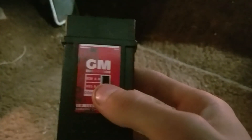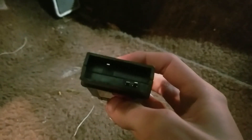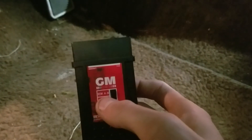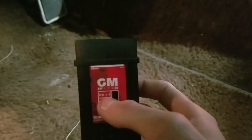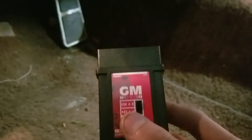Take your scan tool — this thing probably weighs less than a pound. It's got two modes: ECM and ABS. All that is, is selecting which terminals to ground. There are only three terminals on the connector. When you plug it in on ECM mode, it grounds the A and B terminals, which puts the computer into a closed or open loop so it will tell you what codes it's stored. I'm not sure this will actually work for me since my check engine light didn't turn on last time.